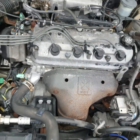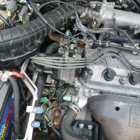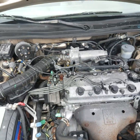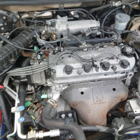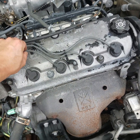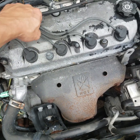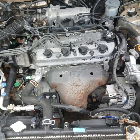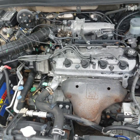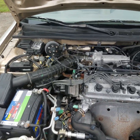The plug wires are bad. How do I know it's just the plug wires? Well because on this engine it's got a new coil, new electronic module, new cap, new rotor - but process of elimination - because this car has been sitting for, I want to say, three and a half years.